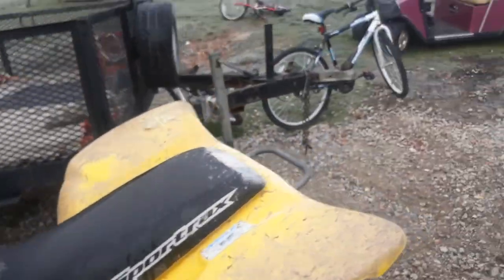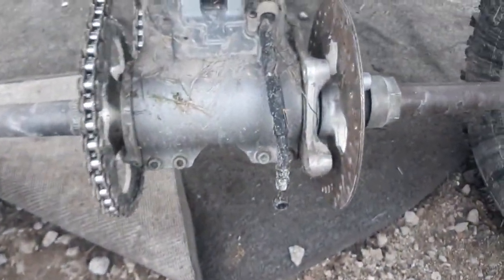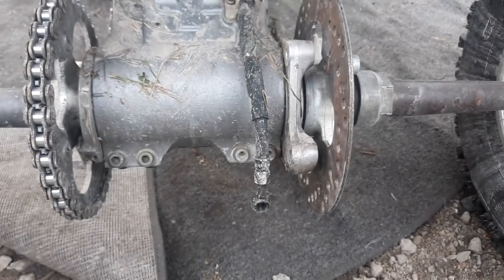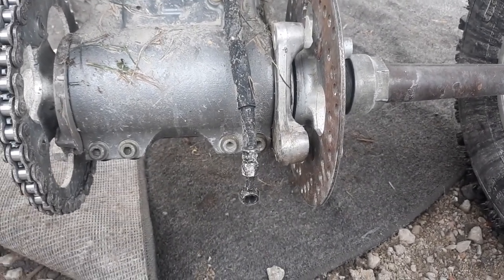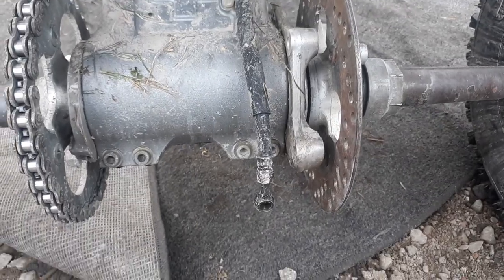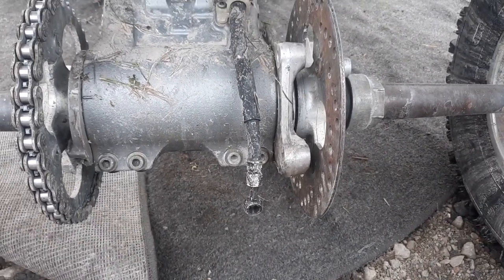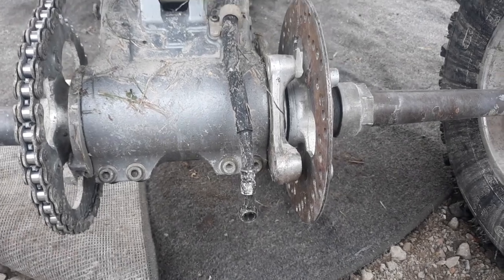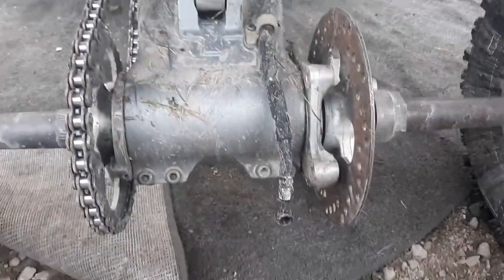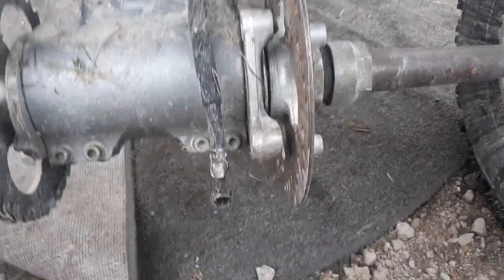The only other problem I've had or heard of is the carrier bearings. I had to replace the carrier bearings on this recently — it wasn't that hard. I was following through the same water as a 300EX, and that guy's carrier bearings were just fine, but mine went out quickly from the water. So I put new carrier bearings and seals in.